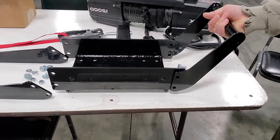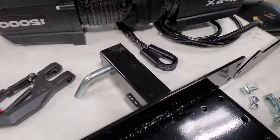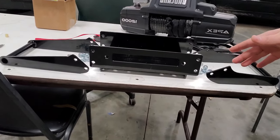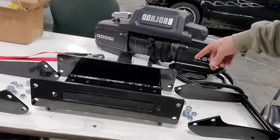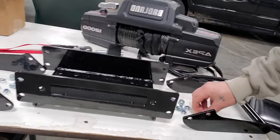I don't think I could build it for 50 bucks, but you got a nice handle so you can just pick up the whole unit and slide it into your hitch. This even comes with a pin. Now the only thing you really need to note is that when you put the bolts in, you're going to want to put them in with the head on the inside, because this unit's huge and you don't want that bolt sticking on the inside stopping it from sitting down in the spot.